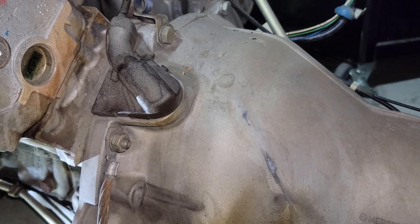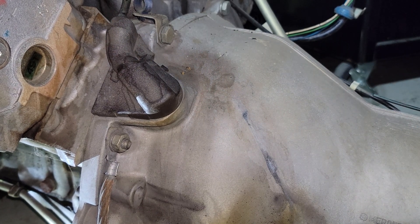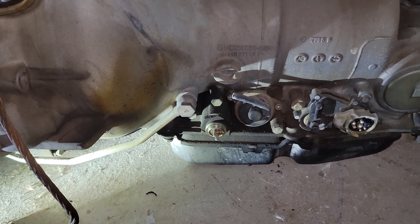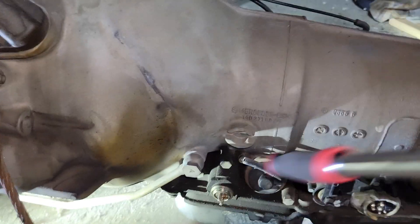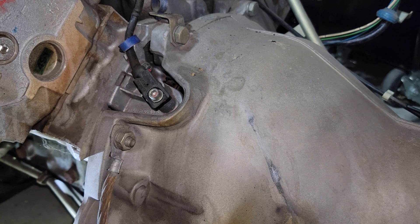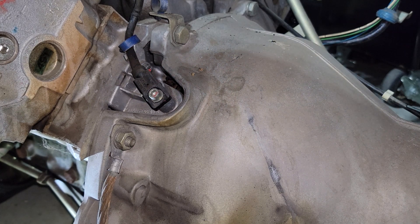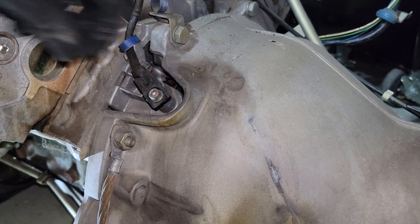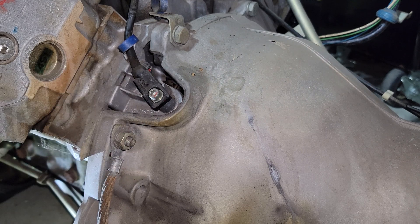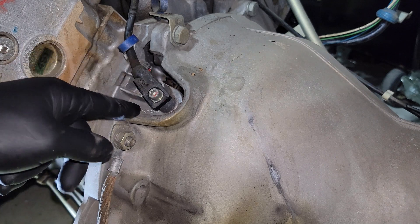What we're going to do is we're going to have to eventually lift this thing up so I can get to the bolts in the very bottom. I'm going to have to take off the transmission line right there — there's another one on the other side, we'll have to do that too, which should also be a 17 as well. We're going to take this off. And then we're going to figure out what that copper wiring stuff is in there. We don't have to take that off right now, but we'll figure it out. That's not actually attached to the transmission.